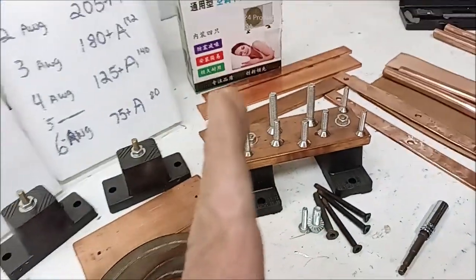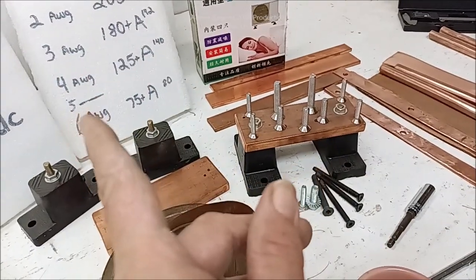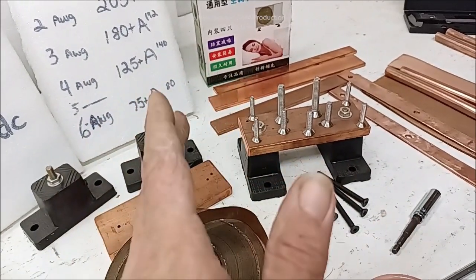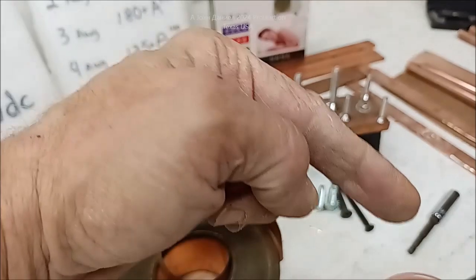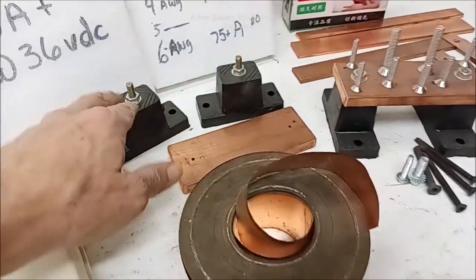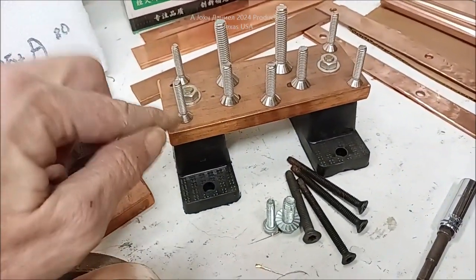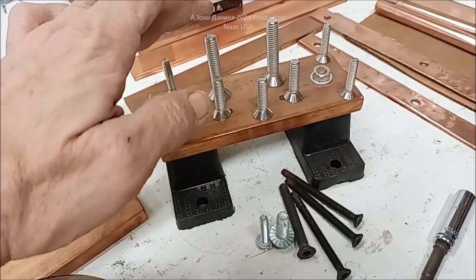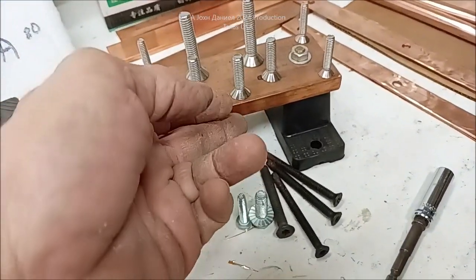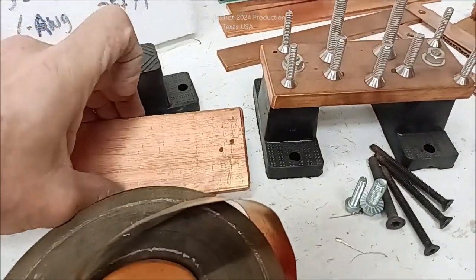Now back over here - this is the main bus bar. You'll see one side is 36-volt and the other side is 12-volt. A lot of stuff is going into this build, so subscribe and look under the video for links. These are the bolts coming through: quarter-inch, five-sixteenths, and three-eighths. This is half-inch thick copper, a full two and a half inches wide.